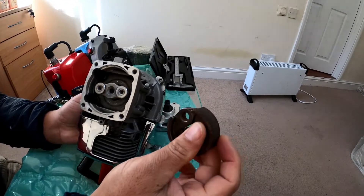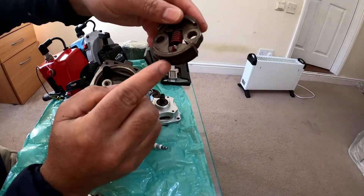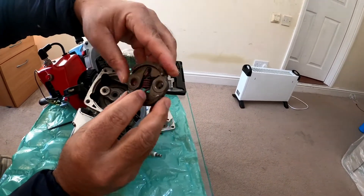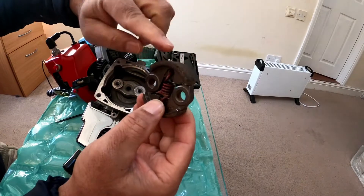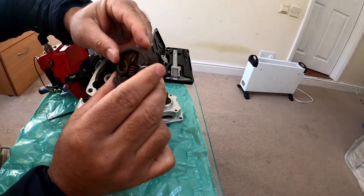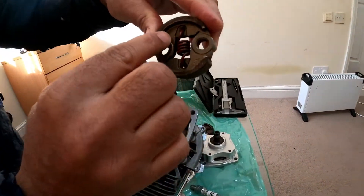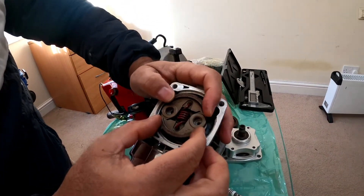You can see both sides of this clutch — all edges on this side, that side, and this side have some rounding. Usually when the clutch is rotated through the crankshaft, this spring extends. Then these edges — you can see these edges — engage into the clutch bell. Then our spindle will rotate over the tire. I will show you how we will install it. You can see these are the arrow signs on the clutch. Make sure that when you install the clutch in this direction, this is the proper alignment.